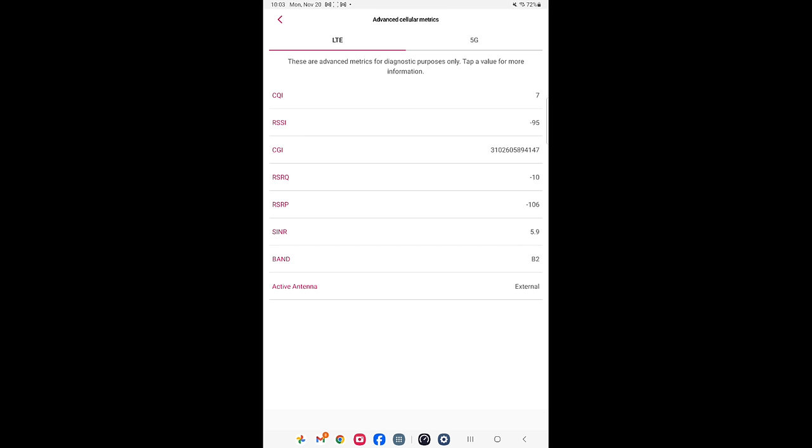All right, so here we are with the T-Mobile antenna now, and I have that one hooked up, cable 3 of the antenna to port 3 of the gateway. This one's a little bit different because of the way the Waveform is numbered versus the way the T-Mobile one is numbered. So again, T-Mobile is 3 to 3. The Waveform is 2 from the antenna to 3 on the gateway. But we can see I'm on B2. My RSRQ is actually good there, minus 8. And then on 5G, we can see it went back to N71, with an RSRQ of minus 11 and a signal to noise of 6.